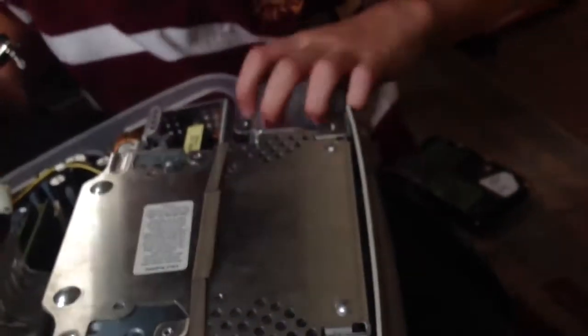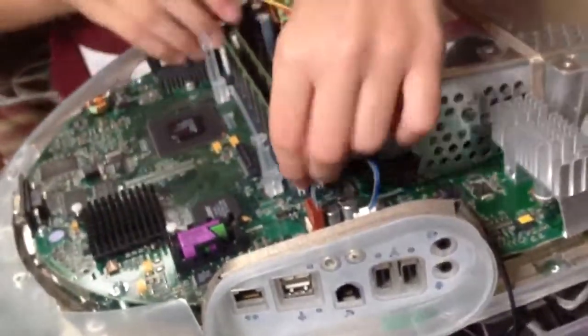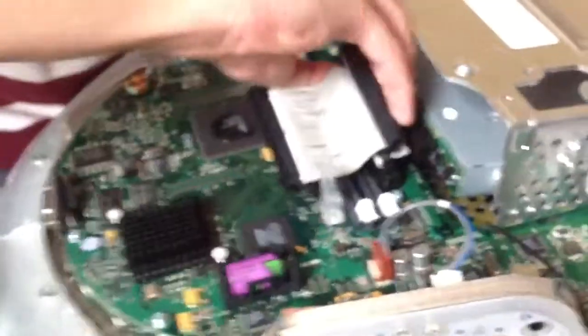Don't touch that part right here — I don't know what that is. I don't think these speakers are removable. You can remove this right here. I'd recommend moving the RAM by pushing these two tabs up — if you're a newbie with computers, there's only one way they go in. Once you get this cable, pull it up and swish it out of the way. It seems like it's held on by a screw here and a screw here, so you can use a normal screwdriver for that.